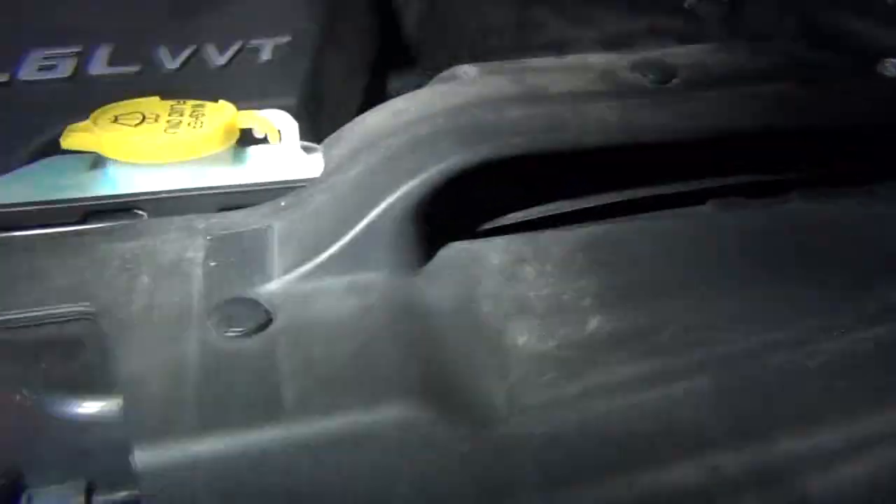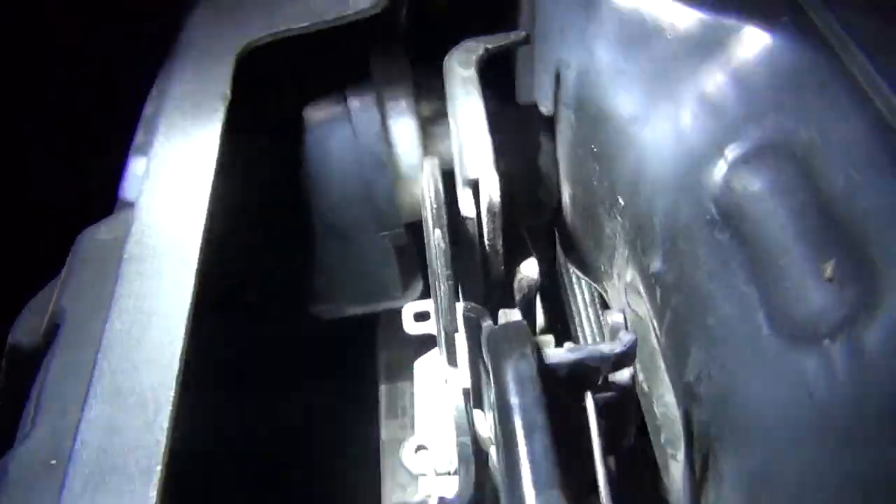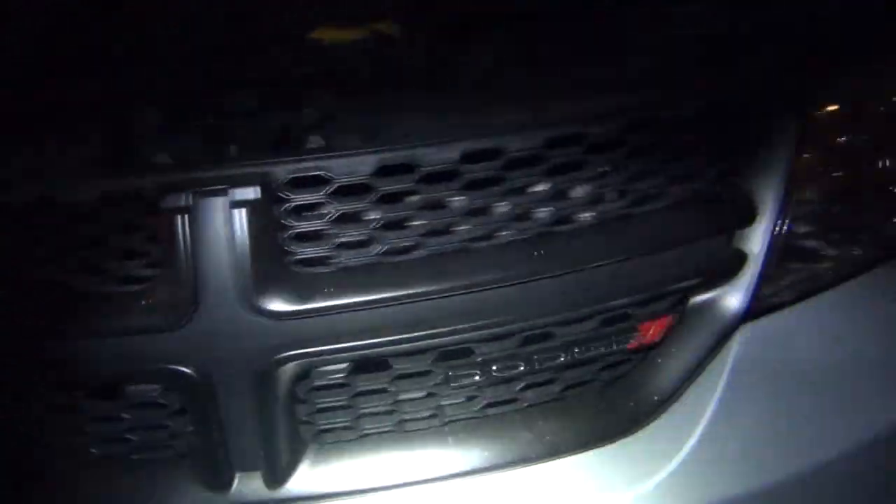You'll need to do that five times — one over here, one here, one there, one there, and one there. On your engine latch, look down in here and you'll see that tab right by the silver. You need to push that upwards, and there are five of them that go along the bottom of the grill. You lift those up and the grill will come out.